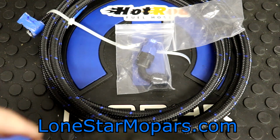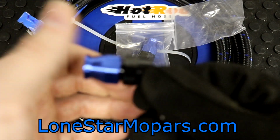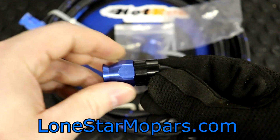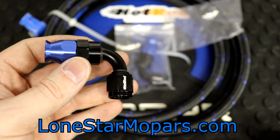In a recent KC Tool haul, I purchased a set of Stavilla feeler gauges, and the reason I did that is when you tighten this down, you want to have a 1 millimeter gap. So that's what I plan to do with those feeler gauges, just to make sure I'm installing this properly.